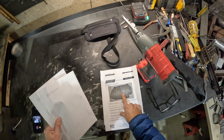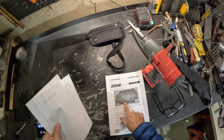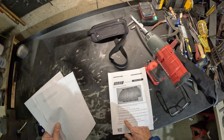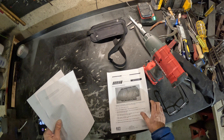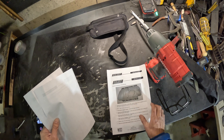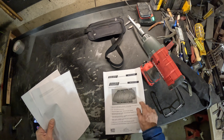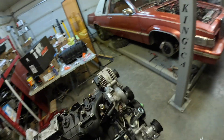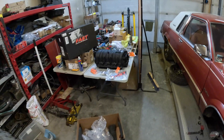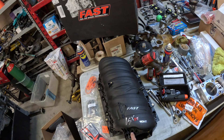Here's all the optional front brake booster — those are all the connections up here. Number five: throttle cable bracket hold-down — I'll have to modify something for that. Number seven: canister purge valve, if you have that. I'm going to put my manifold air temp sensor in there. I've got my manifold air temp right here, and we'll put this into the 3/8 NPT fitting. I made a video on that too.